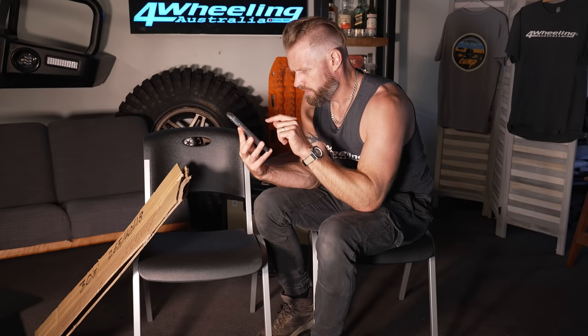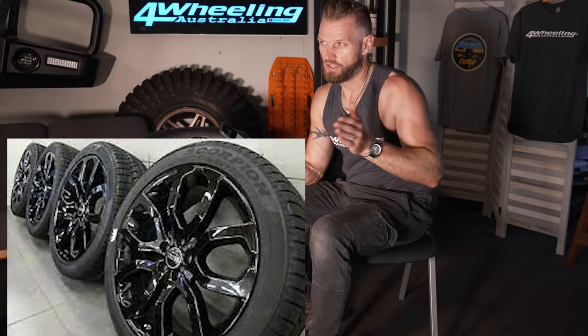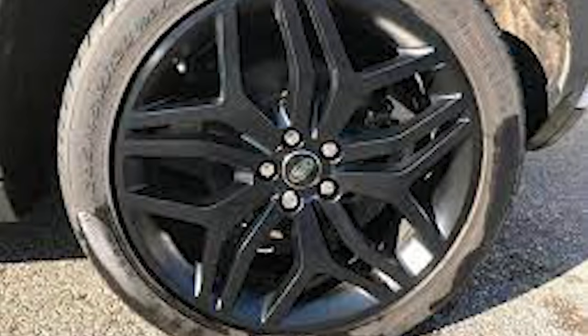This is from experience. On a tag-along quite some time ago we had a Land Rover Discovery, about a 2017-2018. All the Discovery options — the SE, luxury SE — they all have either 19, 20, or 21-inch wheels with very low-profile tyres. This couple had Pirelli tyres on. Pirelli makes amazing race tyres — used in Formula One — but as off-road tyres, as a low profile, they even specify you can't lower them below 35 psi. Below 35 psi there's no guarantee, no warranty. That's what they told these people, because they did two tyres in the space of a day and a half just by pinching the rim. And they weren't even that low — maybe 28 psi. So look at your sidewalls.